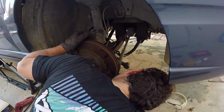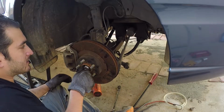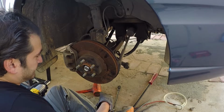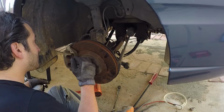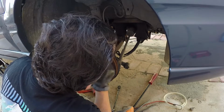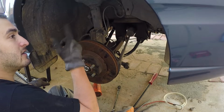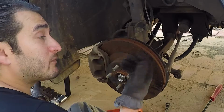I'm gonna go look up the torque specs for that before I take it apart. I've got the axle nut in. Do I wanna just send it with this? No, I'm gonna go get a half inch drive ratchet first, bring it down, and then look up the torque spec for that also. So once that's in, I can get the bellows off, put the new bellows on, change the brakes, and then this side will be done. That side, ball joint and brakes. Ball joint should be faster because I know what to do now, hopefully, and that'll be it.